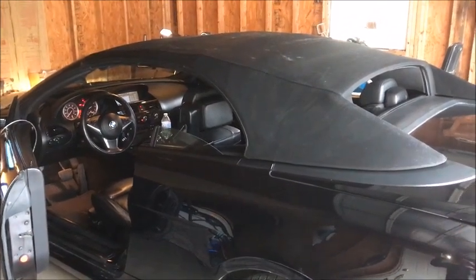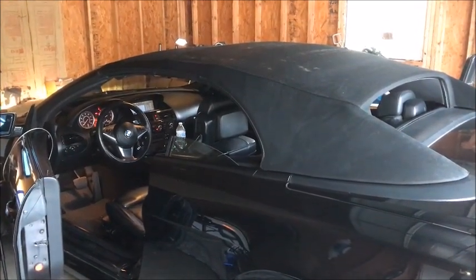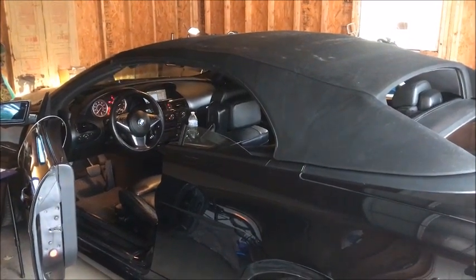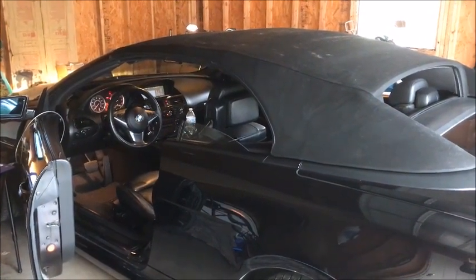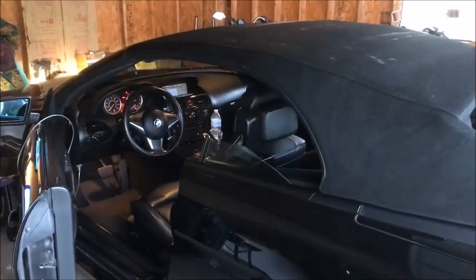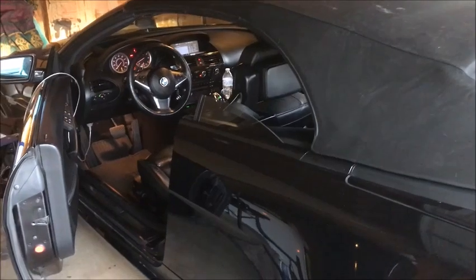It's fall here in Tennessee, and that means BMW convertible owners start getting the top fault. I went through this particular situation about four or five months ago, had everything resolved, seemed like it was working good. But now the temperatures changed. We're going to check the location of the hall effect sensor in the back — the one that when you thump on the back you can get it to reset. If you want to see the other video on the mechanics of it, go to my YouTube channel.